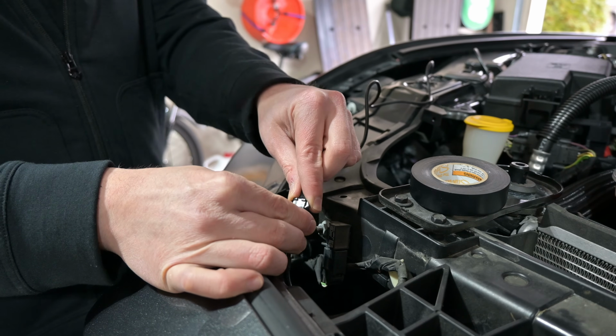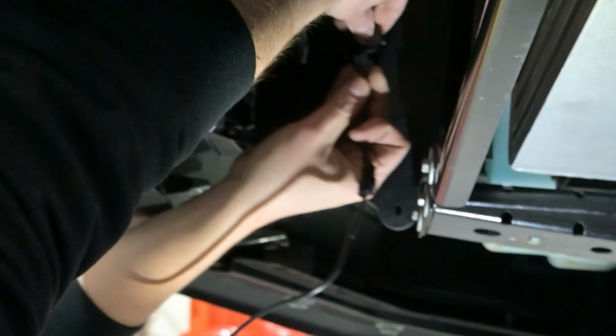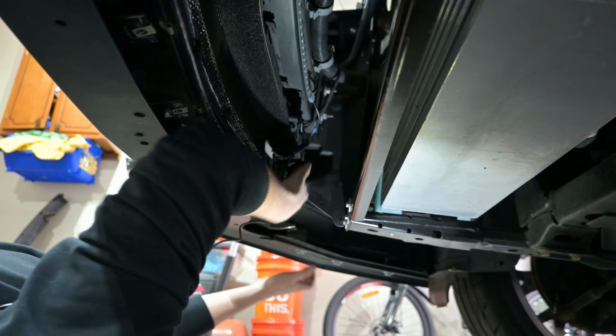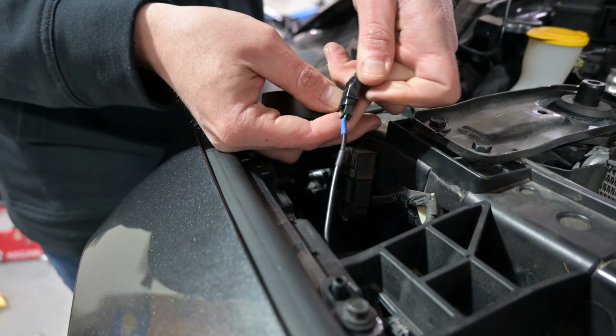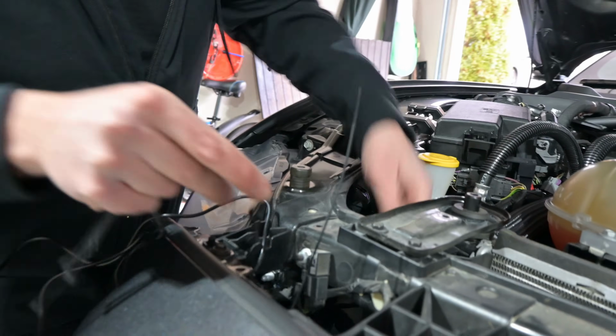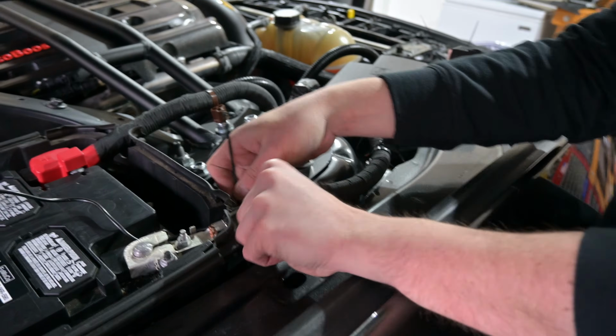Once you've mounted your LED strips, it's time to run the wires to the control module and connect them to power. Use the included pigtail connections to link the LED strips together and connect them to the extension cables. Make sure to use electrical tape or heat shrink on the connections as they are not completely waterproof. Once you have the cables connected, run the wires to where you want to mount your control module and connect to power.